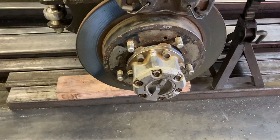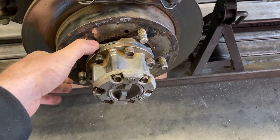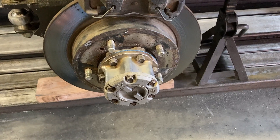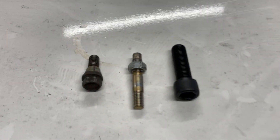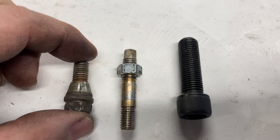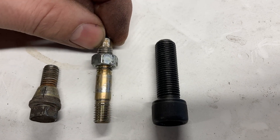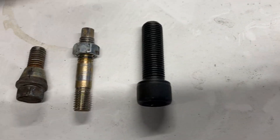A major weak link with Suzuki-based axles are the small 8mm hub bolts, especially when you have good axle shafts - that becomes the weak link for sure. I'm going to show you how to change those out to 7/16ths. Here's the size comparison: stock bolt breaks easy, this ARP stud is actually meant for Toyota but virtually the same - these break just as easy in my opinion. This is what I'm going to: 7/16ths fine thread.